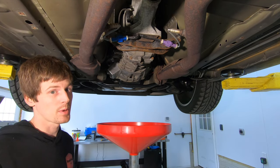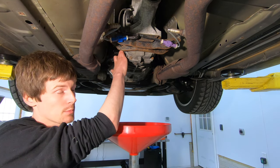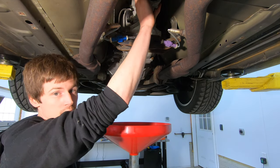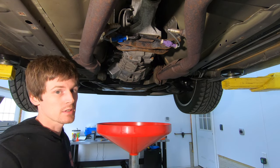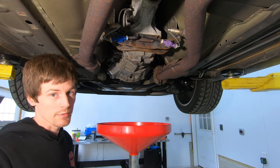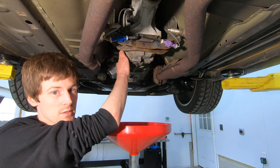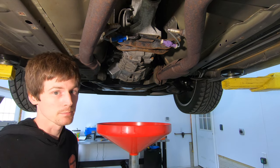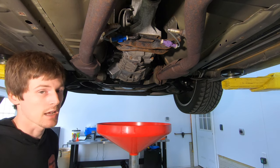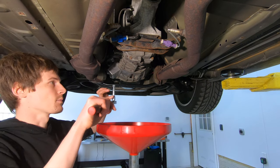This is optional, but I'm going to drain the transmission. You can wrap a glove around the back where the driveshaft comes out, but there's a good chance you'll spill fluid on the floor. The fluid for most of these transmissions is dirt cheap — they just take conventional Dexron/Mercon ATF, about $12 a gallon. Rather than make a mess, I'm going to drain it.